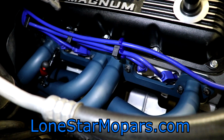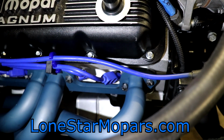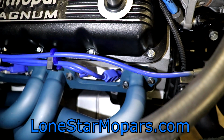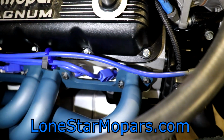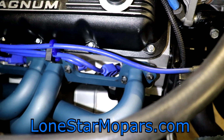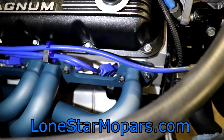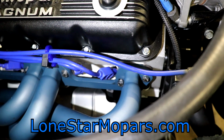Went back to the driver's side. I've gotten it taken care of. This second bolt on the driver's side, cylinder number 1, if you will, it seemed like it was cross-threaded. I didn't know how, and I wound up taking everything out, pulling it back, and got it to go in. It went buttery smooth. Didn't have to tap it. Couldn't figure it out. Basically just started there, then pieced everything together. It's fine, ready to be torqued.